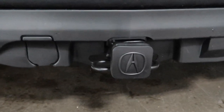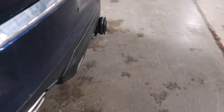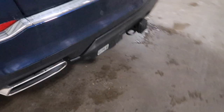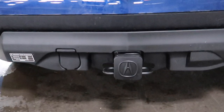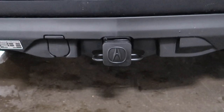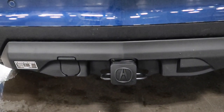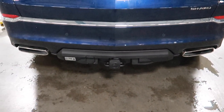Here's a look at it completely installed — I put the little cap in too. It looks good, it's got little loops for the chains if you're towing a trailer. It does not protrude too far outside the bumper, which gives it that nice factory look. One thing I failed to mention: if you have the kick feature for the hatch, it comes with a relocation kit for that sensor. If you're going to do the wiring for the lights, you'll have to remove the entire bumper, and for the 5,000 pound max tow rating you'll need the transmission cooler.